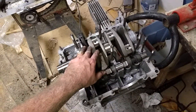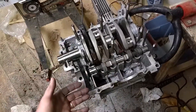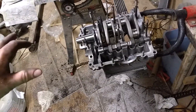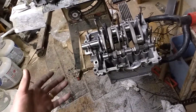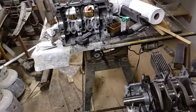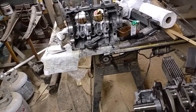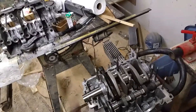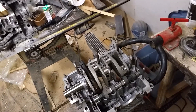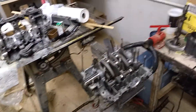Anyway, we'll get the gears on there, get the pistons and cylinders in, move everything around, and get all the rods on so we can make sure everything is clearing — that the rods are clearing the case, that the pistons are not hitting the connecting rods or the crankshaft counterweights. Then we can do the same thing on the other side, clean everything up, put the new pickup tube in, put our deep sump bolts in, make sure everything clears, and start buttoning up the bottom end.